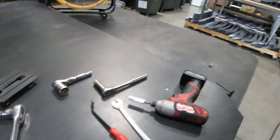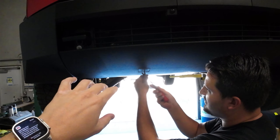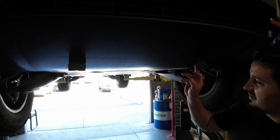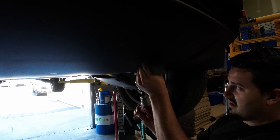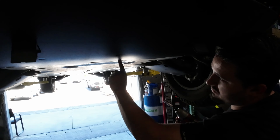Let's show you how to get the old tow hook off. There are two hidden doors across the front end of your truck. You're going to pop those out with the panel clip removal tool or a flat head screwdriver — that's going to gain you access to the bolts in there. Go ahead and undo those bolts; those are 10-millimeter. There will be 10-millimeter bolts across the back as well.